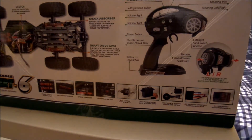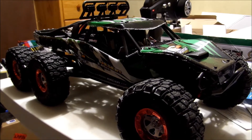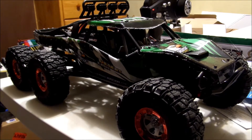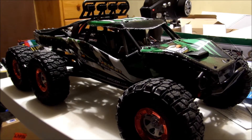It says high torque brushless motor — in other words it's a high torque outrunner brushless motor — a 45 amp brushless waterproof ESC, and a 3-channel 2.4 gig independent receiver. This will be my first brushless vehicle that BudgetGuyRC has ever had. And I was right — it has a 7.4V, 3,000 milliamp hour actual lipo. It's not a li-ion, it's a lipo, with a 30C discharge rate.